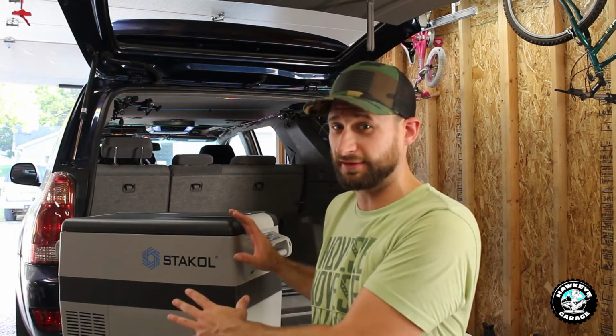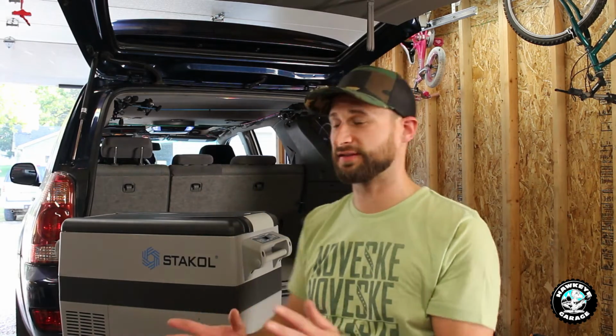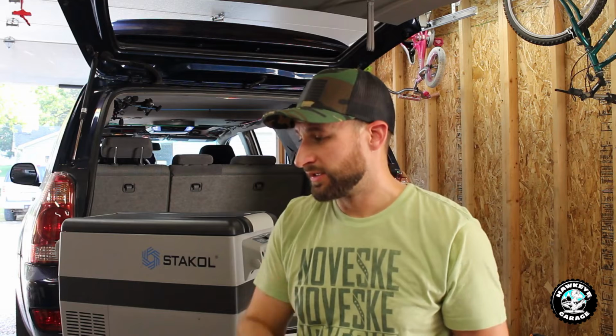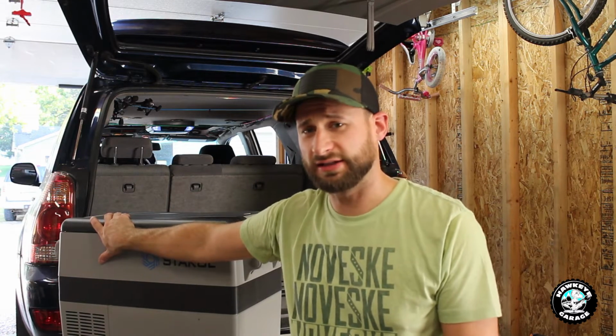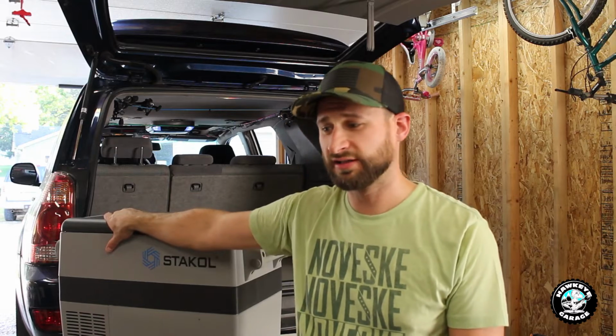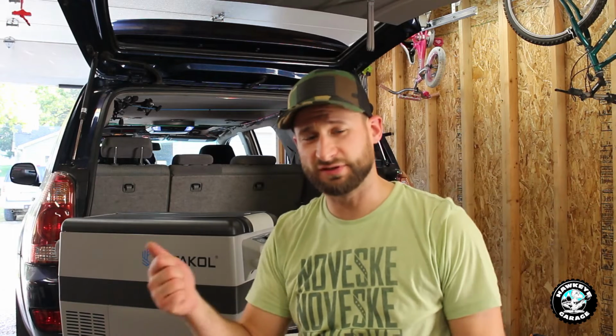There's a lot of information, I know I'm just talking, but those of you who are interested in this stuff are interested in this stuff. So if this has been in your car all day and it's 80, 90 degrees inside the unit when you plug it in, and you throw some beverages in it and go to a cookout and just leave it on, it's going to shut off after you've been parked with the car turned off for a little while. It's really going to want to pull some juice and it's going to sense that it's killing the battery, even though it's not.